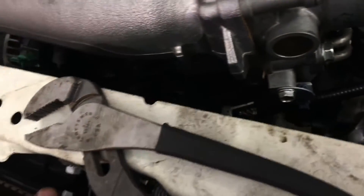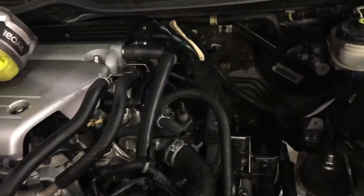There are three bolts on the thermostat — you'll have to get one or two from the top and then one from the bottom, so you do have to get underneath the car to do it. But this is a 160-degree thermostat, which should help keep the engine temps a little bit cooler, especially out here in Arizona.